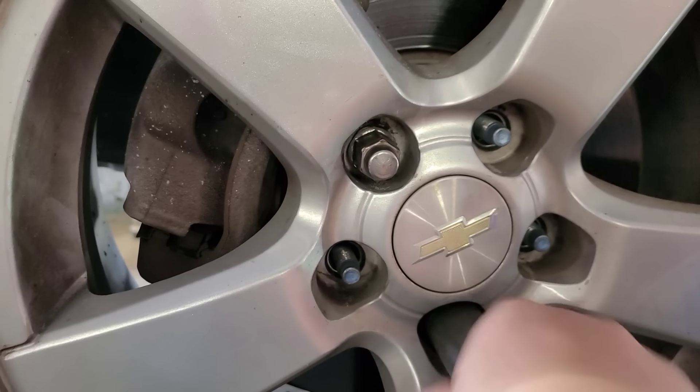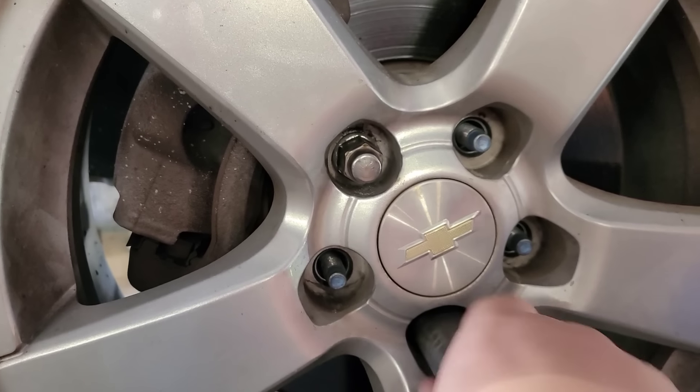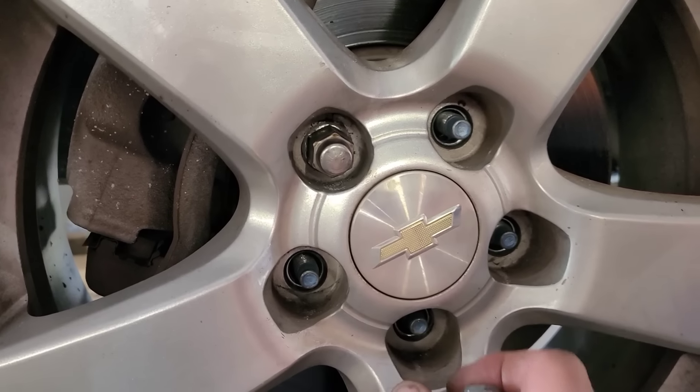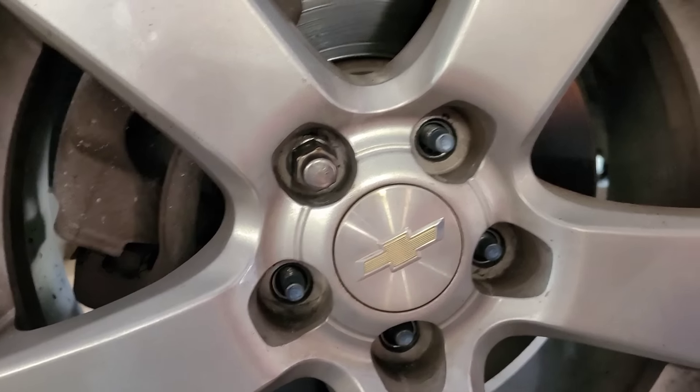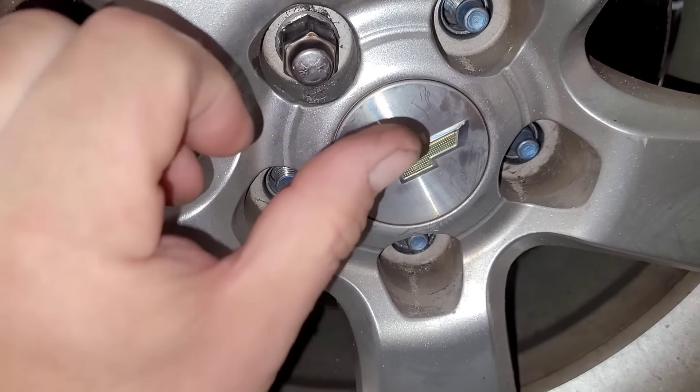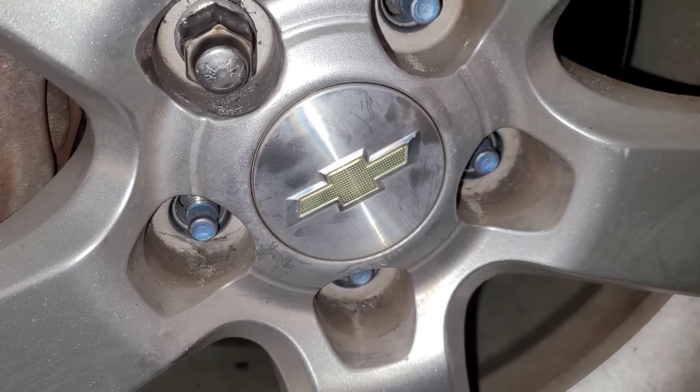The reason I put that one other lug back on was because the whole wheel was loose. What I'm going to do is loosen up the wheel and put a screwdriver or something between the wheel and the hub. Because what I'm going to do is drill this out — I have no choice. So in that gap, I'll slip a small screwdriver, a chisel, or something, then tighten up a lug nut on this side. This way it seesaws the rim on the screwdriver to put pressure on this lug. Because if I go to drill this out and the drill catches, the whole thing's just going to spin. It'll be for naught.